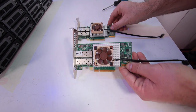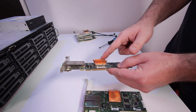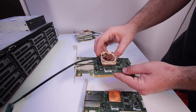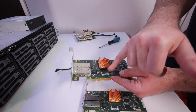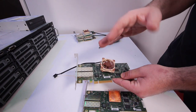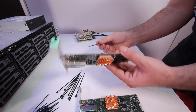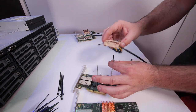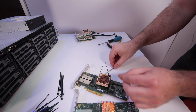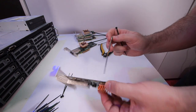I really love how this looks, but there's one downside: the card doesn't fit in one slot anymore. The heat sinks on the Chelsio T420 are much smaller and don't allow you to grip screws into them. Even the 40mm fan is bigger than the heatsink, but on this card we have two holes, so I'm going to use zip ties to mount the fan on top. The Chelsio cards are for my backup file server and a test server, so they're less critical. You put zip ties through the holes, place the fan over them, then take another set of zip ties to make a stop, and cut off the excess. Now we have the fan mounted — let's do the last card.